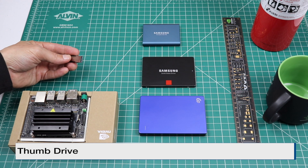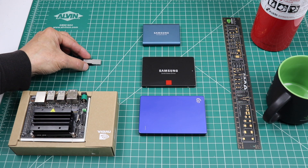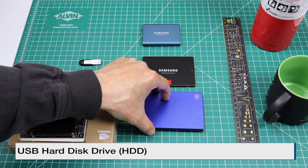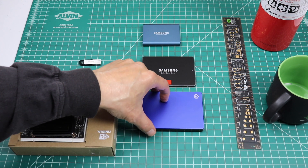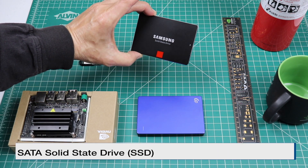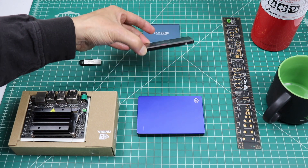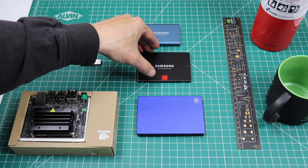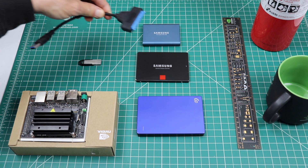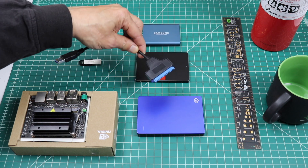Here's a selection of USB drives. This is your typical thumb drive. Just up front, thumb drives are not a good candidate for this method as they do not have good wear characteristics. This is a hard disk drive — this one's about two terabytes, and it's probably the most reliable over a long period of time. This is a SATA SSD, about 256 gigabytes, which will require a special adapter to go to USB. I'll leave a link in the description below to all these devices.